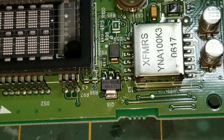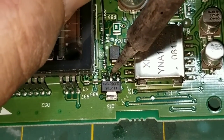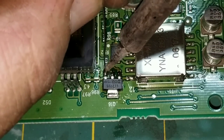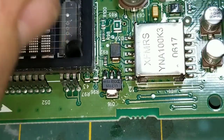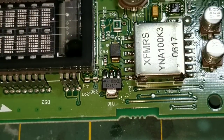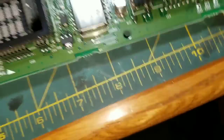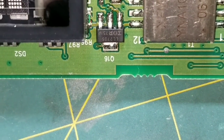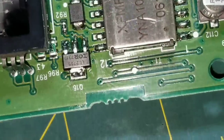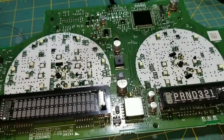Just like that. I'm going to grab our solder, put a little bit more on the end. Make sure we don't have any cold joints. And that's all there is to it. I'm going to get a Q-tip and some alcohol, clean this up, and then I'll give you a close-up view of what it looks like soldered on. So there it is — all soldered back on. We've got a good connection. I went ahead and checked it with my continuity tester.